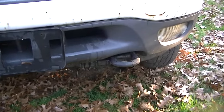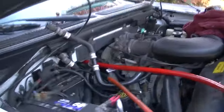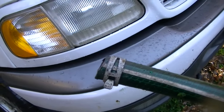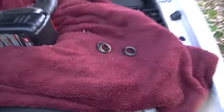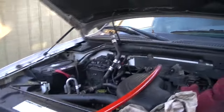Let me take the camera off the tripod and show you my setup. I've got a couple of hoses - this one I just have a clamp on it to kind of snug it on there, and the same for this one. I just stuck a clamp on there to help it out - kind of a poor man's version, but hey, whatever works. Now all I've got to do is put these seals back on and shove my hoses on - that's all you've got to do. And that's one way you can flush out your heater core before you go out and buy one.